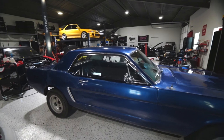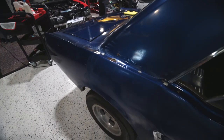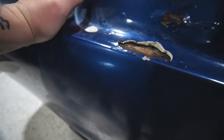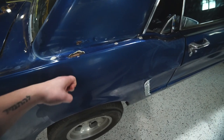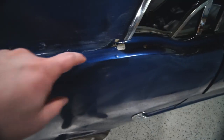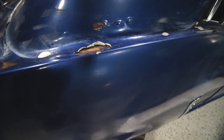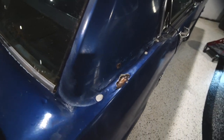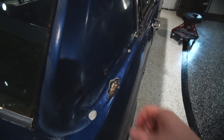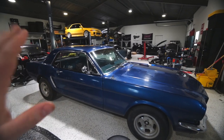Just finished wet sanding with the really big pad and I was about to go with the three-inch pad to get all the small spots, and I noticed that stuff was peeling up right here. There is a ton of Bondo. I'm not sure what exactly happened. Anything that's white right here is going to be some body bond. I don't know how high it goes — that makes sense why it didn't stick. Maybe they just didn't prep the Bondo well enough. It looks like it just goes in there a ways. Kind of curious if this car got sideswiped or something and the body shop didn't do a great job.